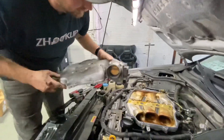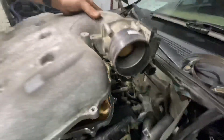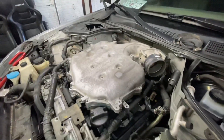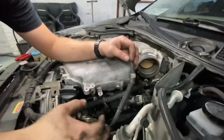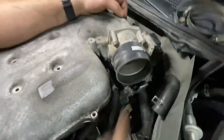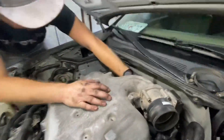The top of the manifold here is going on. One thing we need to do is connect these coolant ports here to the throttle body that we took off earlier. That 90-degree fitting is at the back of the motor here, so without damaging the gasket I'm just going to rest this here. That line is on. Then we've got to flip over to this side — this is where we can run into a couple issues too, because this other line has to fit all the way underneath the throttle body. Go ahead and slide that on — pops right on. These are the vice grip clamps that were holding the coolant — just pop those off. Line's completely good right there, and we've got one on the other side. Pop that off so we're not leaking coolant all over the place.